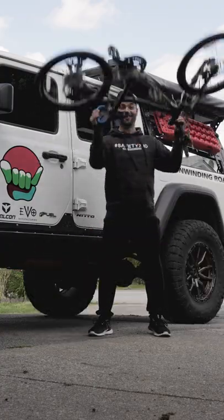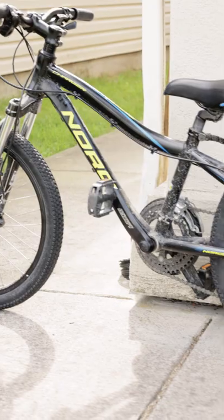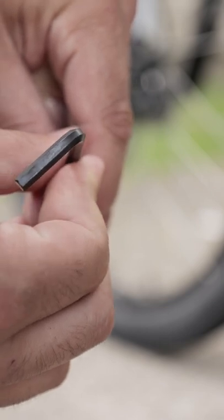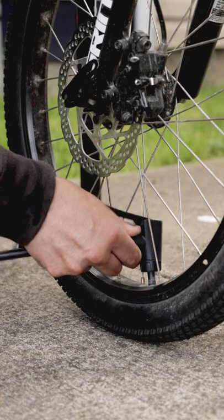Use a bike — I'm using my son's bike. Small tire, less air, this job gets done quicker. Turn the deflators up, adjust, and check as you air down. One full turn is about 3 psi. This way you won't have to keep pumping up the bike tires.